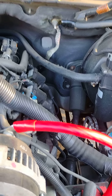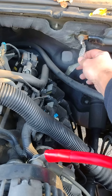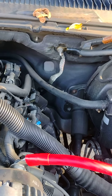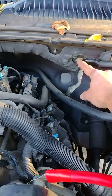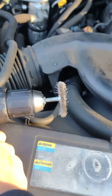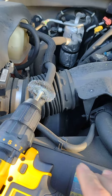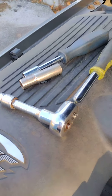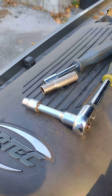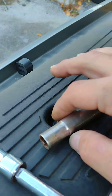I started with the most simple and easiest to reach fix, which is this wire here. I removed this nut, which is a 10 millimeter. Simple tools I used were a wire brush and a drill with a wire brush attachment. I only needed a few sockets — two 10 millimeters and an 8 millimeter, because the bolt on the cover is 8 millimeter.